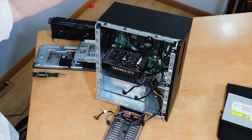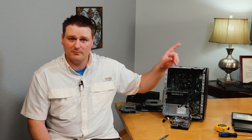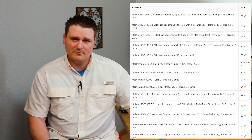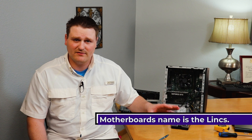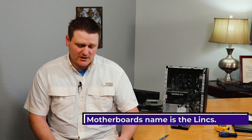We're back and I got the case off. I'm going to start talking about the different Intel CPUs you can put in here. You can put the ninth and eighth gen in here — it allows a bunch of different processors. I'll have a list up here and also in the description. What this board and power supply allows is up to 65 watts. So if it's anything below 65 watts, eighth or ninth gen, you're good to go. This is an H370 chipset, and you cannot use K processors.